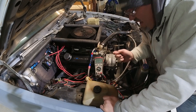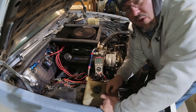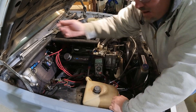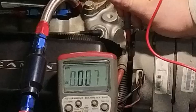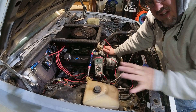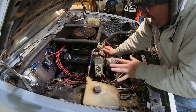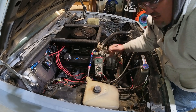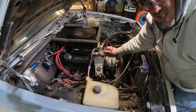The next most common test I do is alternator output — is it actually putting out voltage? This is where something with a clip is handy. Since my battery is at the back it's too far, so I'm gonna grab hold of my main ground lug or negative, and with the car running you want to touch the lug at the back of the alternator to make sure you're getting voltage. The voltage you're looking for while it's running is anything from 13.5 to 14.4 volts. Anything less or battery voltage means it's just not charging. Most of the time when it's running you should be seeing 13.56 volts and higher.